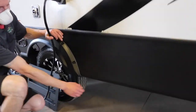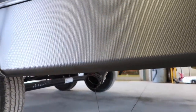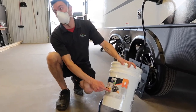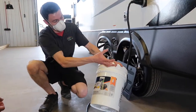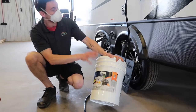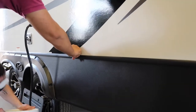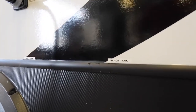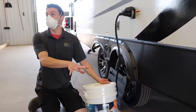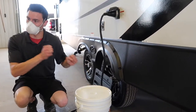There's a cap at the bottom that twists off. The starter kit hose is 10 feet long, which is really all you need — it twists on where the cap came off and goes 10 feet into the ground. You've got a gray tank label and a black tank label. The black tank is your toilet waste; gray is everything else. I always recommend dumping the black first since it has the most material in it, then the gray helps wash the line.